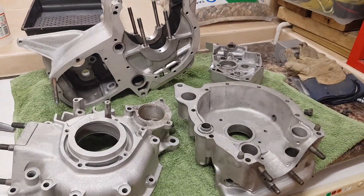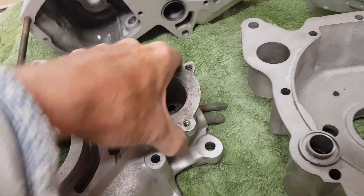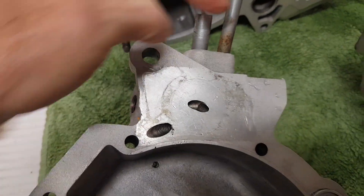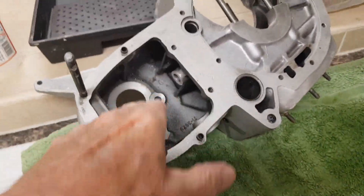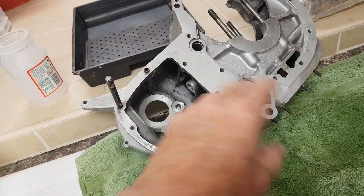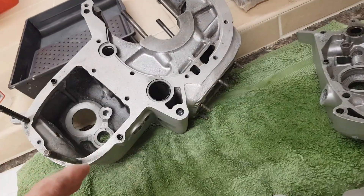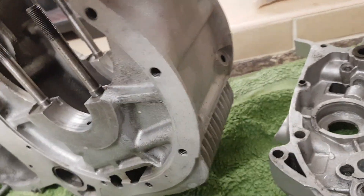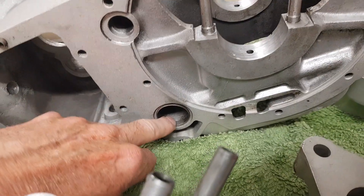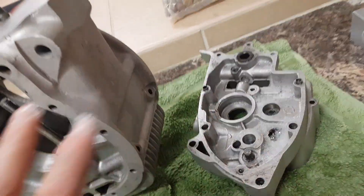Phase one of the cleanup is done and they were really dirty. I had to give them a really good clean, especially all around the oil pump because there are so many oilways in here. Another area was actually inside the gearbox — they're not blasting inside the gearbox but all the dust settles in there, and there are little shelves the grit loves to settle on. I also cleaned all around the oil filter and these drillings that go all the way through the crankcases to the oil filter and up to the mains. I've also done the inner gearbox cover.